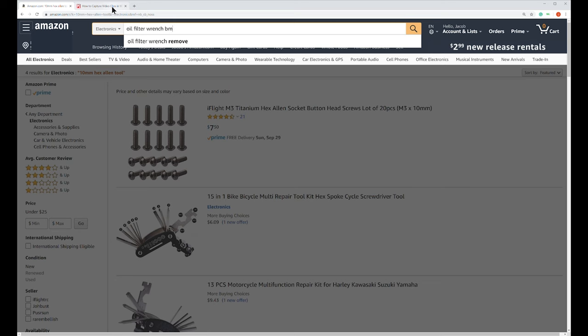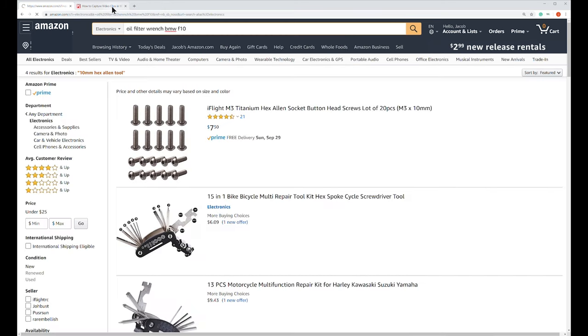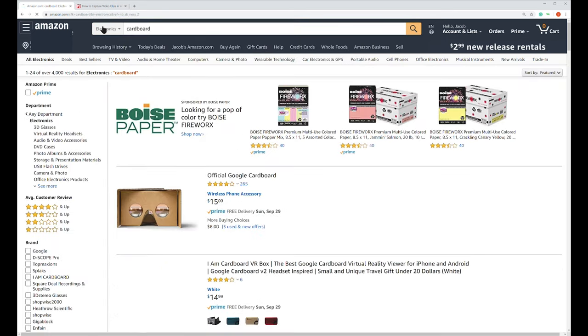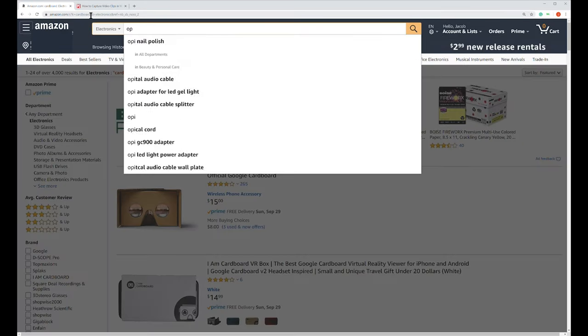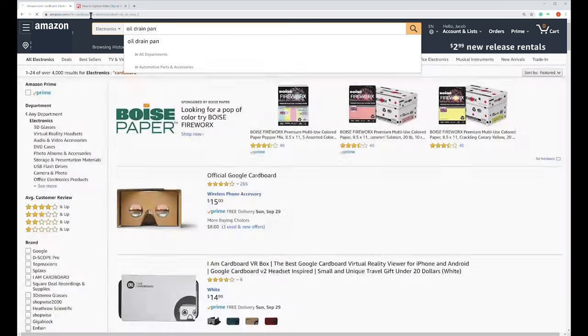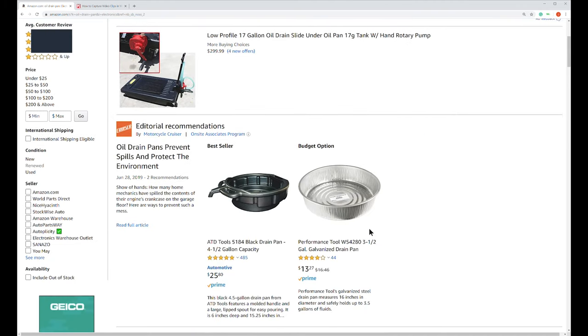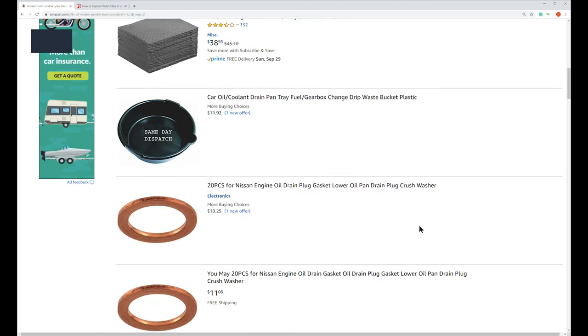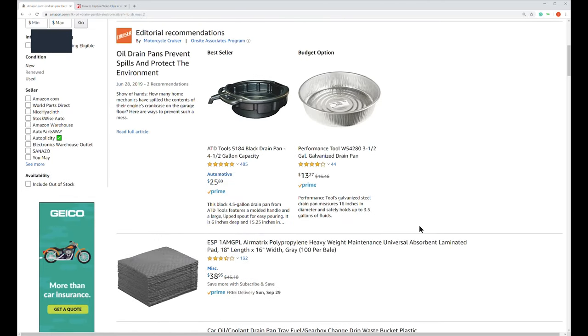On top of the engine you need to remove the oil filter, and you're going to use an oil filter wrench — I'll put a link in the description below, I bought one off Amazon, it worked very well. No sense messing around with something that doesn't fit correctly. You can put it on a torque wrench and torque it to the right torque spec. You also want to have some cardboard to lay down underneath the engine — it helps you slide around and absorbs any oil spills. I also put down an oil cloth, and you'll need an oil drain pan, which you can get at AutoZone or on Amazon.